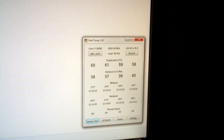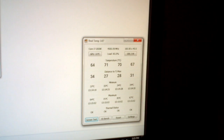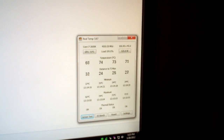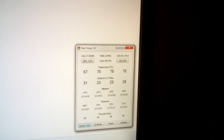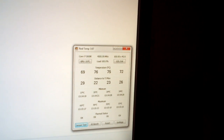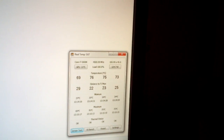Right now they're in the 60s, and they should go much higher than that. I think the highest that I've pegged with Linpack running is around 80C. My Arctic Silver 5 is freshly installed so it's not quite cured — it needs around 200 hours. So I do anticipate temperatures going down a little bit from 80C. I'm hoping to stabilize around 75C to 77C.